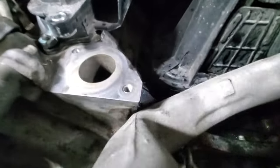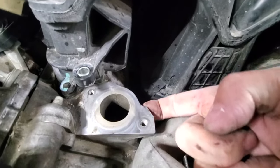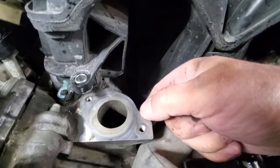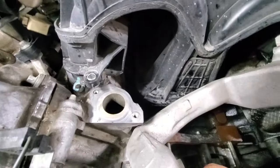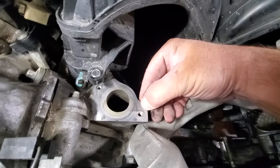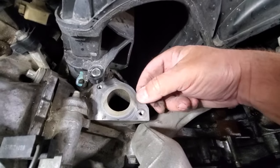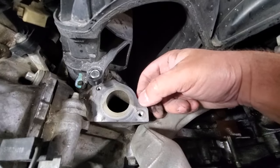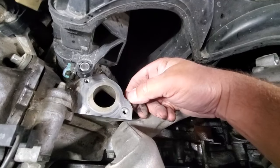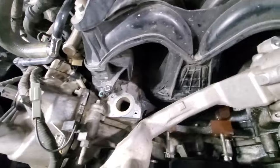And here's that piece I was showing you, just to give you an idea. There's actually quite a bit even still under here — it's just a little bit that kind of hangs over the edge there. It's nowhere near the surface. I've already cleaned it off. The gasket actually stays well within this area. I could probably take another eighth of an inch off of it, but you'll see what I'm talking about when you get in there. It doesn't serve any purpose — it just comes straight out. It's essentially just a little overhang piece that you have to remove so that thing can slide out.